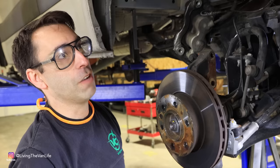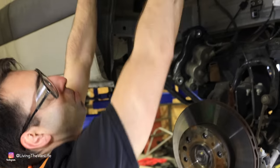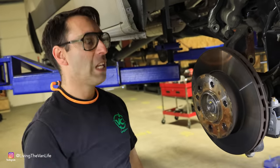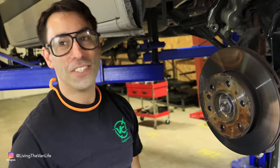You can get up to a 35 inch tire with just a little bit of trimming back here on the pinch seam. So at full bump, you're not just gonna be smashing the fender. So proportionally, it'll look really good. It has the same suspension geometry, so handles just as well. And then we're gonna be pairing it with the Falcon shocks here soon. So it's gonna be the whole package.